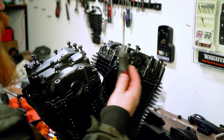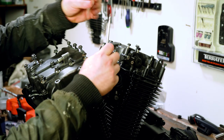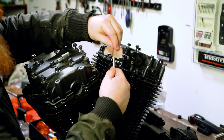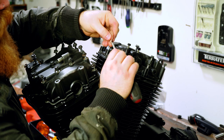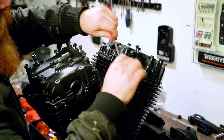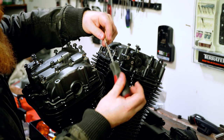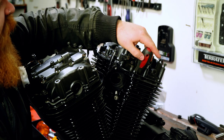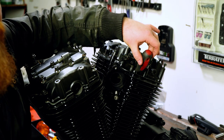The next thing I'm going to do is grab a screwdriver and put a bit of tape over the top. We will need this in a moment, but I don't want there to be any sharp contact between this screwdriver and the piston, because we are going to use this down through the hole of the spark plug to find top dead center.